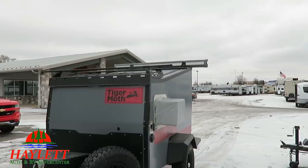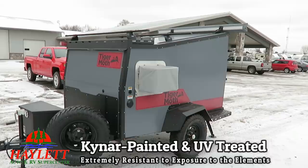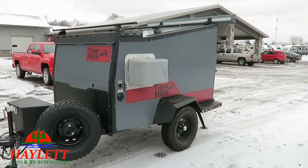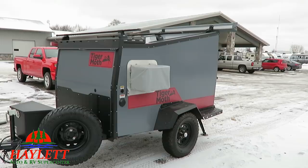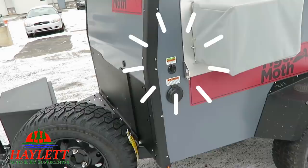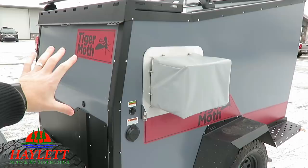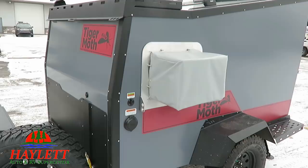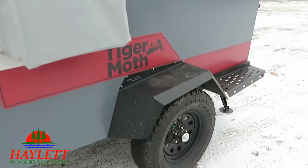The skin on this is different. It has laminated walls and roof, but with an aluminum skin — not fiberglass — and it's given a Kynar painted coating. I had to look that up. It's very similar to automotive paint; it is just very heavily weather and UV resistant. This thing is just a big metal beast and it's going to stay just the way it is. Being more off-grid friendly, you have a simple side-mount solar prep plug. The side-mount air conditioner can actually be easily removed — the whole silver mount just unscrews — and the European-style window that would cover that opening is stored inside the RV under one of the benches. So if you don't care about the AC and you're going fully off-grid, you can replace it with the window for better airflow.